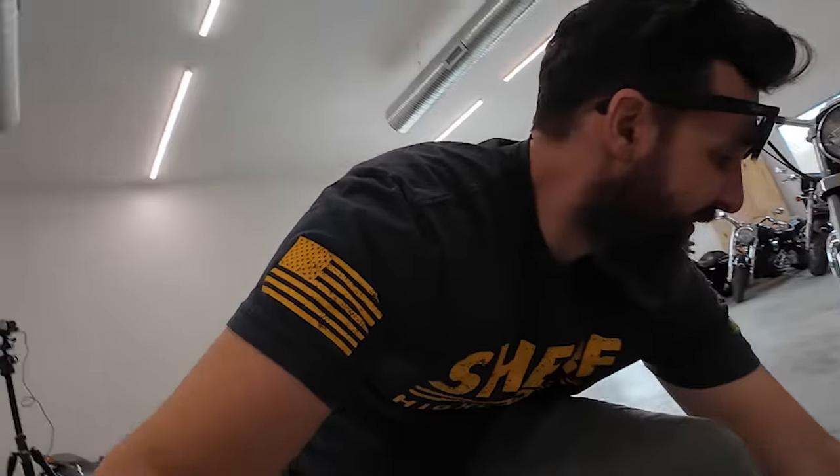Here's the big moment - before we take that off, just a little protection because she's never been run and this tank is immaculate. Great news - it's bone dry. This is just the gasket. That was probably the original sealant they put on that. Rear brakes are working - they work. Let me show you the box of stuff that came with it. It came with a different top clamp and they had different bolts in there too. Your tach wire would go somewhere on the transmission - it's going to go right there, running off your cam compartment, which gives you your cam speed and ultimately your engine speed.